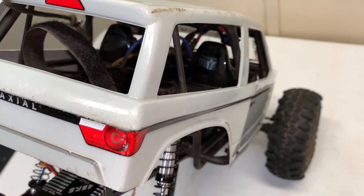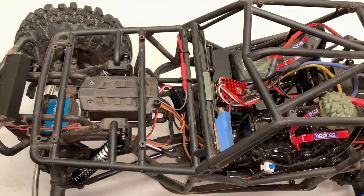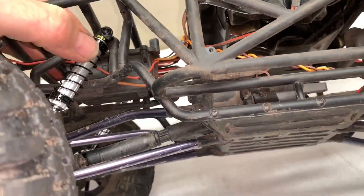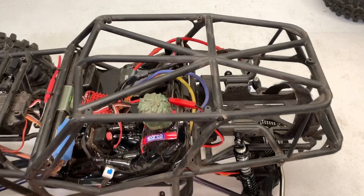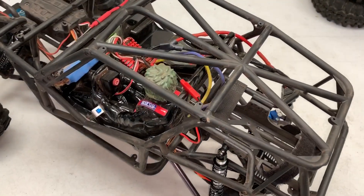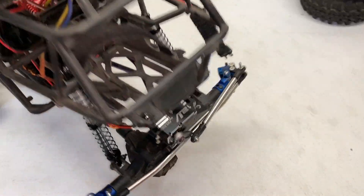As far as the electronics, I've already done it — I got wrapped up in the build. Here is your receiver box, and that's one of the receivers in it right there. It works with a hex FlySky — good for six channels — got wires and stuff shoved all up in there. You have to take this bar out right here — two screws, use a 2mm hex — then that bar has to come out on both sides, that piece comes up, and then you can take the lid off and now you're into the receiver. The wiring had a few joints in it already, not the prettiest, but I was able to use those rather than cutting into the wires. I did have to use a servo wire extension because the receiver is so far away from the rear steer servo, but other than that it's pretty much ready to finalize.